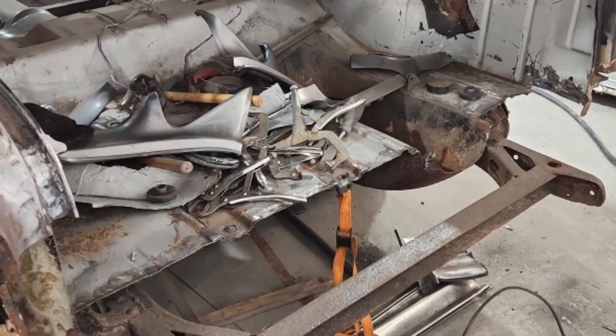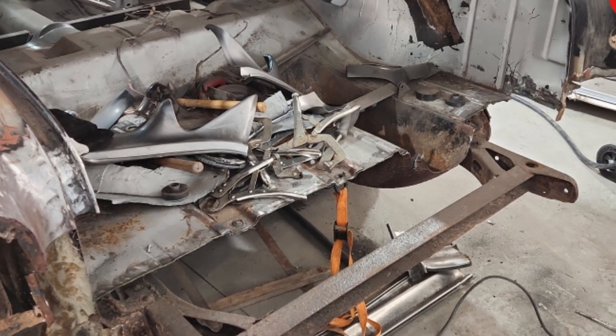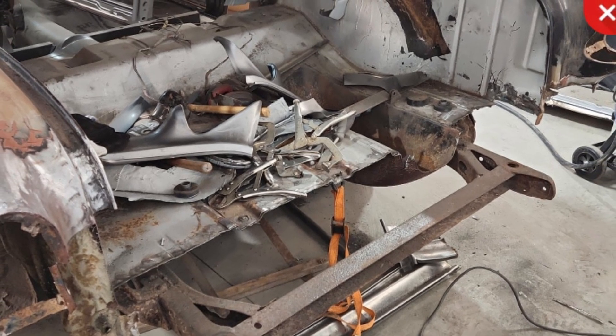I was thinking about lining up my door gaps and I can't really do that with the body off the car. I couldn't do it before I pulled the body either, because I needed to weld the underside of the rockers and there were other things to do. I spent a bunch of time getting the car strong enough to pull it off the frame. Now that it's off, I need to focus on doing the work to get it back on the frame, and then I can square up the door jams and align the gaps.